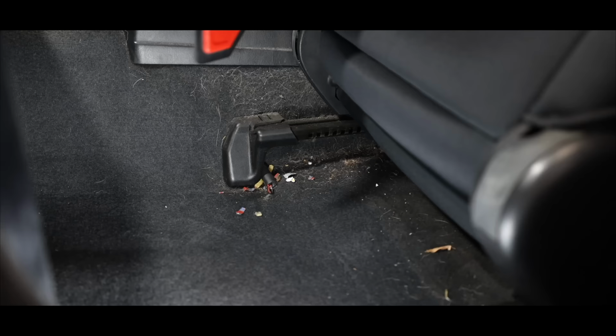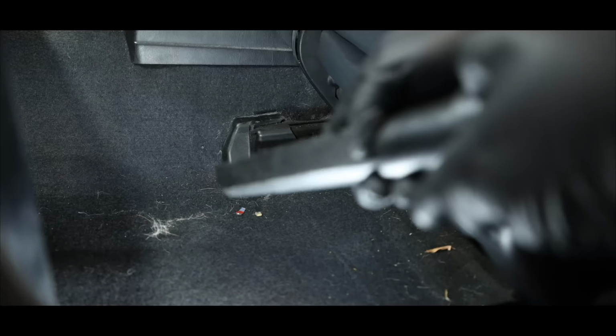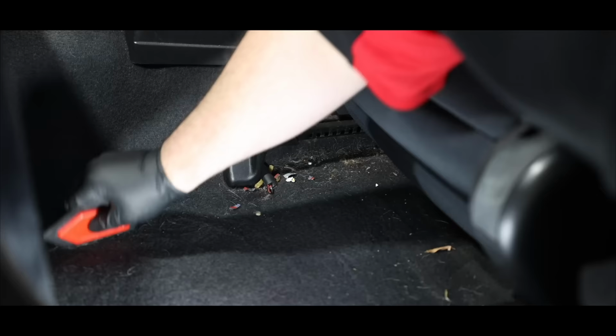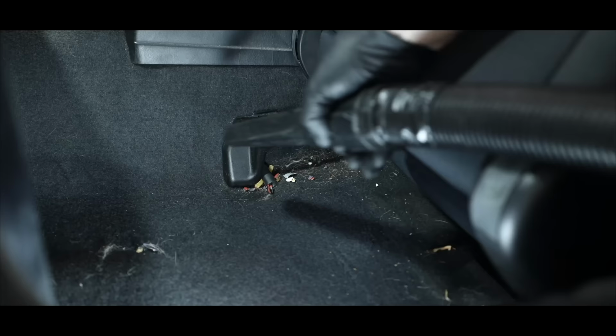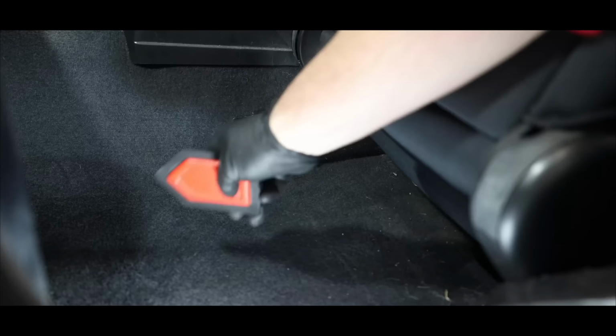The main thing to appreciate about why this process is so vital to get right, apart from the obvious cleaning result, is that dust, dirt, and particles create an abrasive-like muddy consistency when mixed with cleaning liquids. So if you start spraying on your interior cleaners and scrubbing the surfaces with all that dirt and dust in place, it tends to lightly scuff the materials and trims. And over time, when repeated, this is at least a contributing factor to interior trims looking hazed, weathered, and prematurely aged.